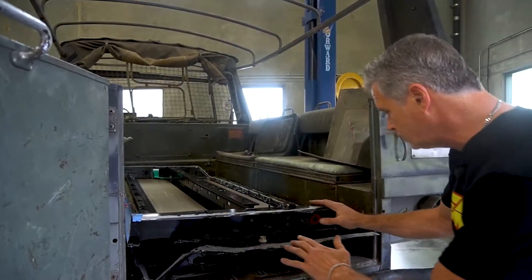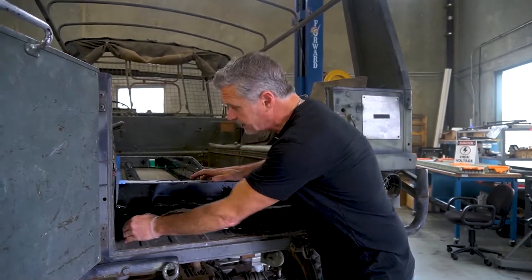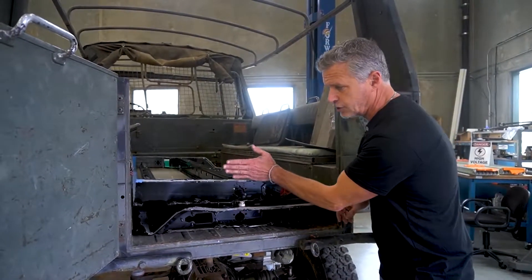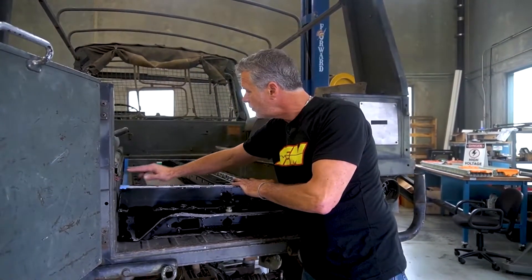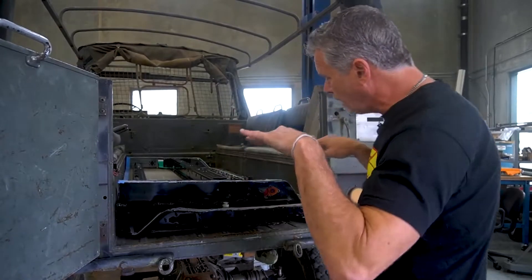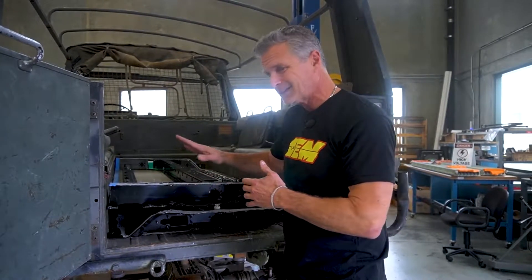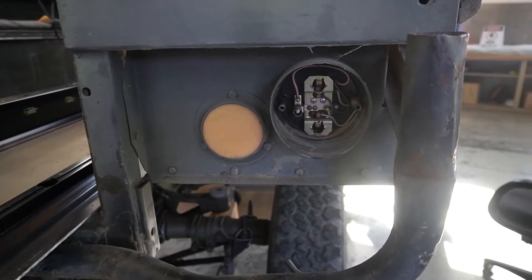That gives you an idea of how nicely they fit. The goal is going to be using the front end of these — there are some major structural parts where you can actually tie into a crossbar — and then using all of the factory mounts down each side to capture the side of the battery on both packs. At the tail end we'll use some of the factory mounts, shorten this up just slightly, and crossbars will tie in the back so the packs will be really secure. This is going to turn into sort of a flatbed — all the hinge bolts for the existing bench seats are going to get turned into crossbars, and there'll be a T-slot that runs down, then we'll have a flooring that slides in, fully supported, so it seals off this whole package. We're talking about 75 kilowatt-hours — that should give us some pretty decent range — super safe, super secure, and still using all of the factory cooling Tesla engineered into these battery packs, along with the structural rigidity that's built into them.